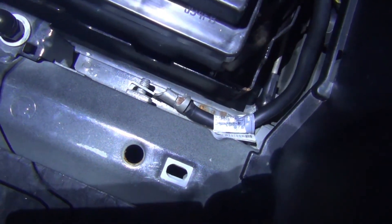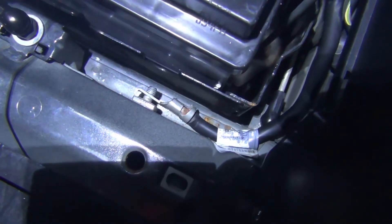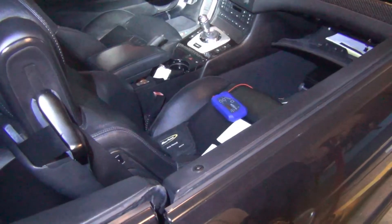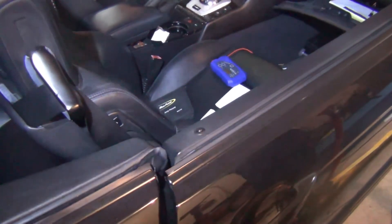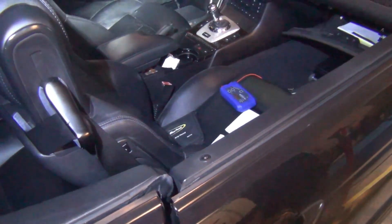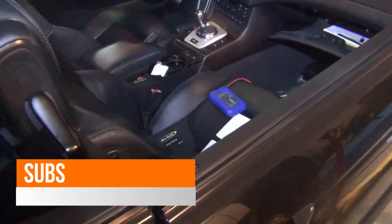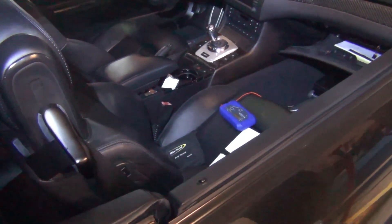I put my ground back on, and just one final note — you want to check a car both locked and unlocked, and sometimes after you drive it, and sometimes just letting it sit and waking it up and opening the door and playing with the electronics. All of those factors could come into play in order for you to recreate the situation that's creating the drain. I'm going to go ahead and lock this, monitor it one more time, and make sure everything's good before I put this together and give it back. Thanks for watching — hope this is helpful. Likes and positive comments are appreciated and please remember to subscribe.